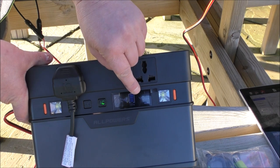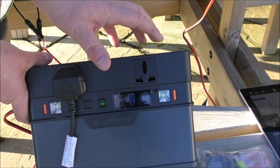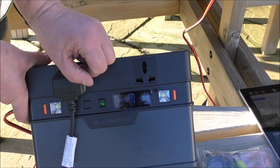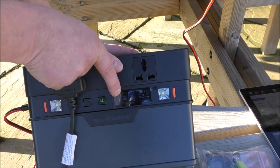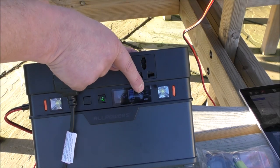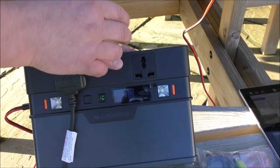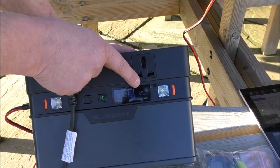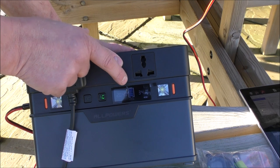That's based on it drawing approximately 40 watts. So if it draws 40 watts to feed the little computer, it'll last 17 hours 42 minutes or thereabouts. Now you'll notice these figures change — if the wattage drops, the remaining life increases; if the wattage being drawn increases, the remaining life decreases. It's never constant when going to a computer because your computer's doing all sorts of different things — it might draw anywhere between 35 watts up to 40 or 50 watts depending on what the computer's doing.